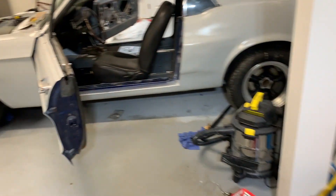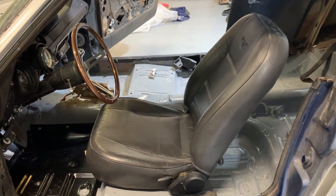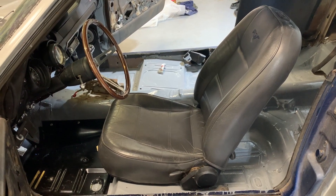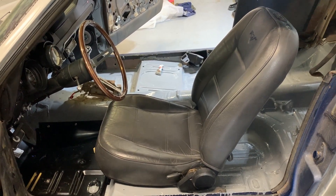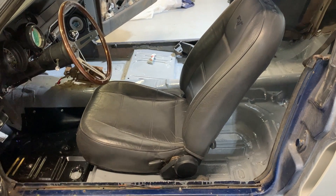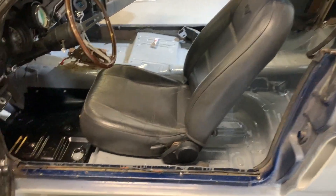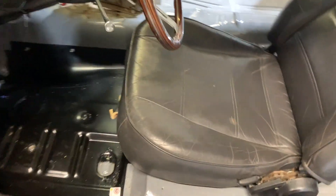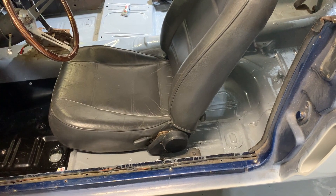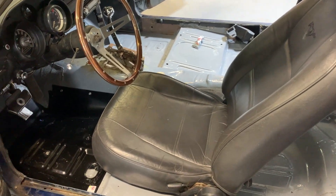It was a little harder for me because I foolishly got a power seat from the '04. It has a different frame — it sits on top of the motorized mechanism. So it took me a little longer, but it's still doable. Same concept. If you do get a power seat, just take your time and it'll be a little finicky. It'll also be harder to maneuver the seat forward and backward due to the electric seat rail. Best case scenario would be to get a manual driver's seat, but if not, you're not out of luck. Let me know if you have any questions.